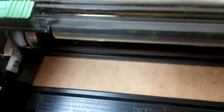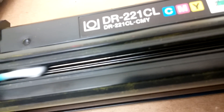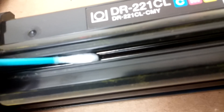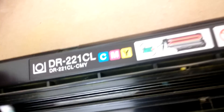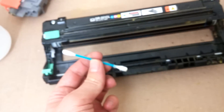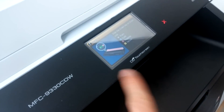I did do some research. Brother says no matter what, never put any cleaning solutions on this — so don't use your rubbing alcohol or anything. But just gently, you can feel the obstructions on the wire. Rub this across and clean those up. Now, interestingly, after many, many times of using this manual tool and then trying this cotton swab, I was able to get rid of the warning and print again.